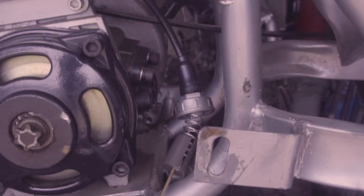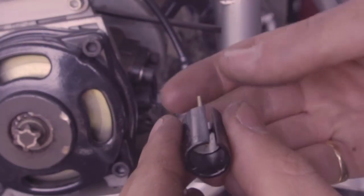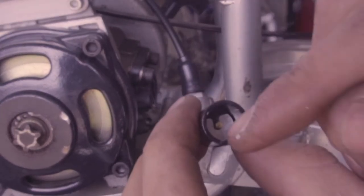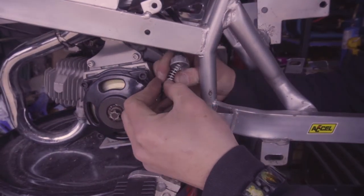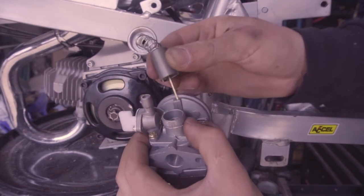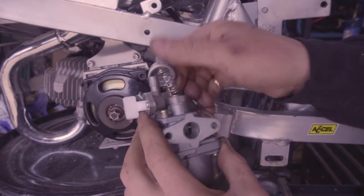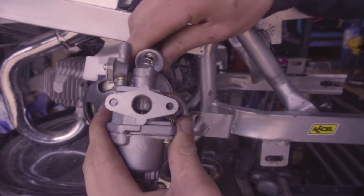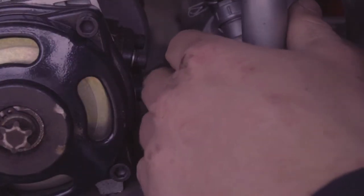Start by putting the cap back in. Inside, there's your needle — make sure not to drop it. Inside there's also a little washer that spins, and you want the hole of the washer to be aligned with the channel. It has to be open, because if it's spun around you won't be able to get your throttle cable in. Compress the spring as much as you can down the channel, hook up the throttle cable, and you're done. The needle has to face the opposite side of the adjustment screw. Push it in, close the top, and that's all there is to it. Then reverse the steps — put on the gasket, bolts, air filter.